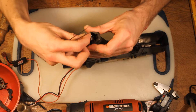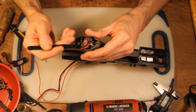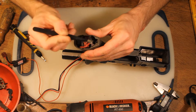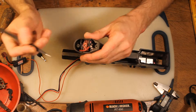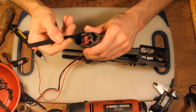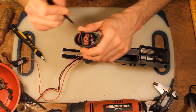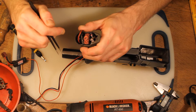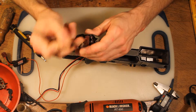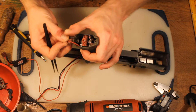Within the pistol grip here we've got the motor sitting inside with two wires going into it — a red one and a black one. This is a good thing to take a picture of. Almost always the red one, the positive, is at the front, but I've noticed on some it's not, so you want to make sure. Most motors will have the pin for the positive marked — this one has a little bit of red varnish on the pin and a positive symbol at the front. These are simple clips that just pull off; some of them have screws.